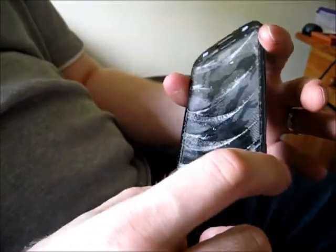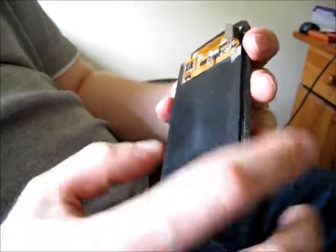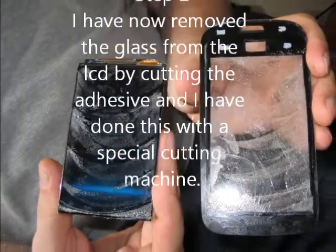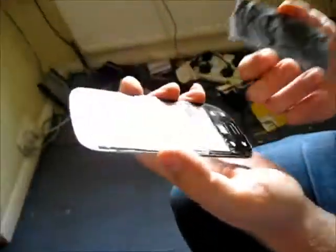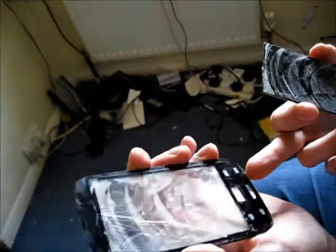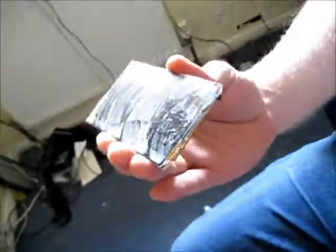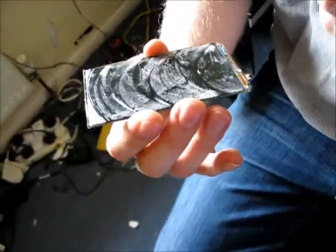This is a broken glass of a Galaxy S3, and on the back I've stuck down a Galaxy S2 with a broken glass but a complete LCD intact, already removed from the chassis. This is the original glass stuck on to the Galaxy S3's glass for more purchase. You can see vertical cracks going from the base. That's the LCD digitizer I've cut away — it's in perfect physical order. I just need to clean off the excess adhesive so there's no debris left.